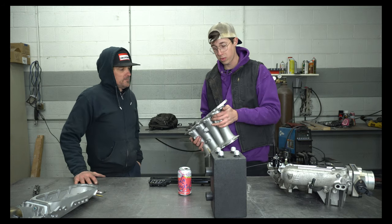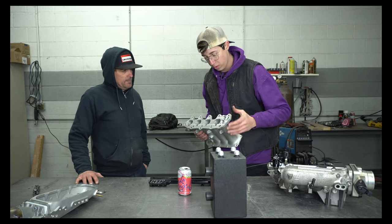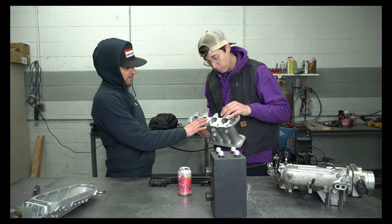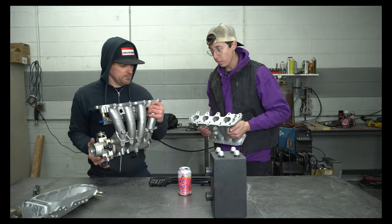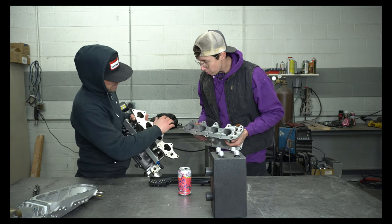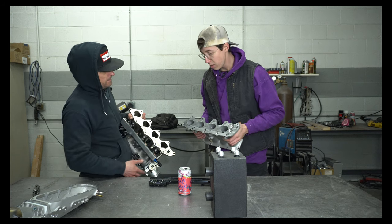So in the next video, when we're working on this intake manifold and these runners, what are we gonna do about porting this side? Yeah, we're definitely gonna address this side. This is probably gonna be a pretty significant difference, because if you're looking at your stock car, you can see how the ports are on here and it's a little bit cleaner. So we'll be able to get them all lined up to your cylinder head perfectly. If you want, we can grab a head real quick and just match it up. Yeah, let's go over there.